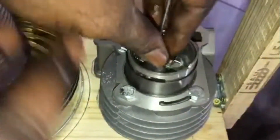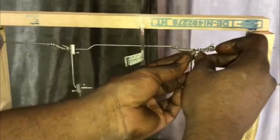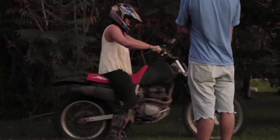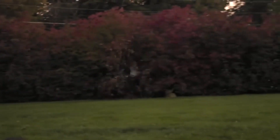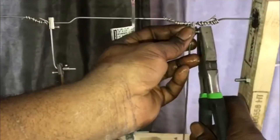Now, this is a four-stroke. If you want to build this style, this is a four-stroke piston. The two-stroke won't work, and the reason why the two-stroke won't work is because it has the ports for port timing — it has the ports in that block. So you can't use a two-stroke block; you have to use a four-stroke block if you want to do that setup. By the time you do the stroke, it comes to where the port is, so it doesn't work.